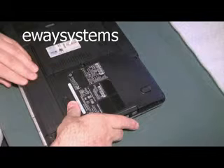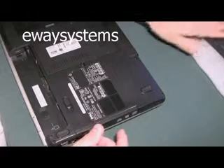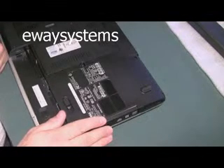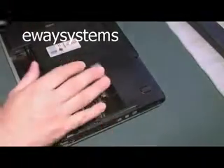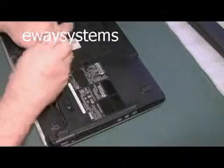When somebody spills something in a laptop, I don't even try to power it on. The first thing I do is pull the AC adapter out, power down the laptop, pull out the battery. You don't want any charge in this thing. That's the advice you should give somebody if they bring their computer in — pull that battery out and don't even try powering it on. We're going to have to open it up, clean every part inside first, and then see what happens because you don't want to be responsible for frying the laptop.